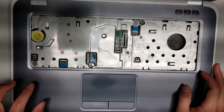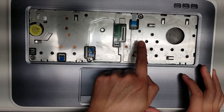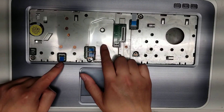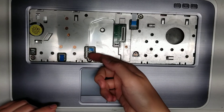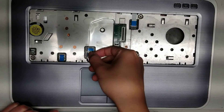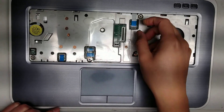After you do that, there are four screws under here: one here, second, third, and fourth screw here. Remove all those, and then undo all these cables. Just flip up the black latch, just like the other one, and then pull the little blue tab to get them out. So flip up all these little tabs, get the blue tab, and then pull it, just like that.